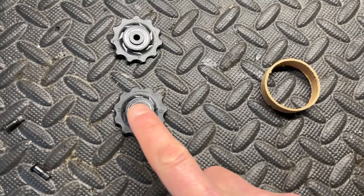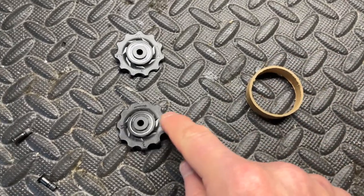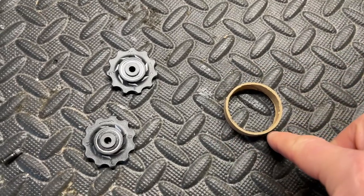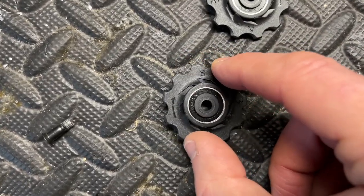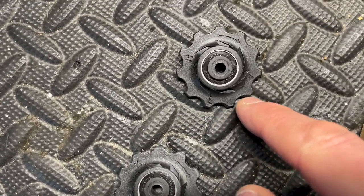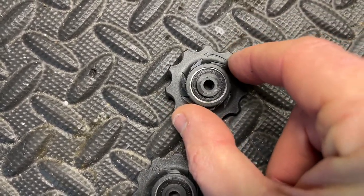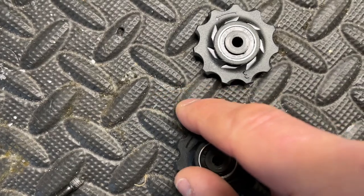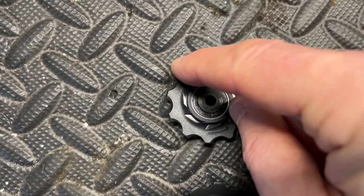So these are directional. I've just made a little diagram here to help me. As we pedal, this is the crank, this is the derailleur. As we pedal around, the chain moves this way — it's going to come under this one and turn it this way around. So the arrow is pointing in the right way and the chain will come off of this one onto this one and turn it this way around. So we need to flip it because the arrow is pointing the wrong direction. So we're going to go under this one, following the arrow, chain will come up onto this one and go that way around.